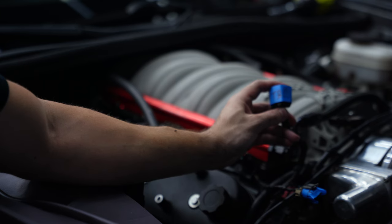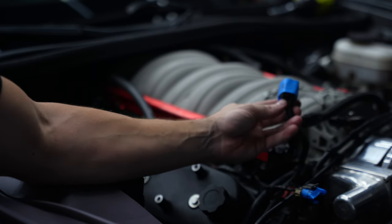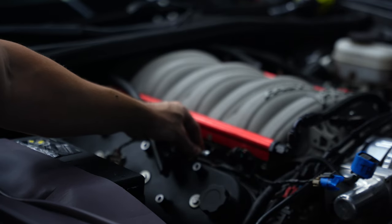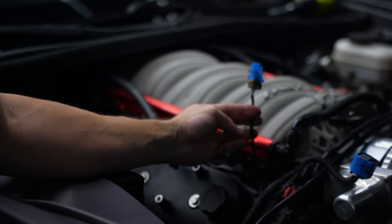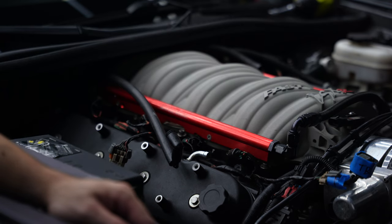Since I'm a noob at what I'm doing, I am taping up the actual plugs and labeling them as I go — so this is the throttle body, this is a TPS sensor. That way, since I'm removing all the harnesses, I can avoid any confusion when piecing it back together. I'm just taping them up as I take it apart and hopefully that'll make my job a little more seamless when I go to put it back together.